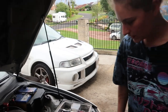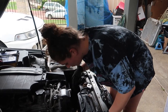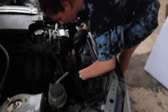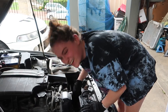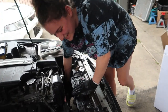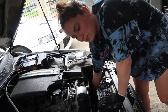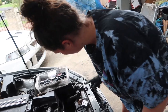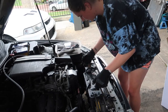So we have to take off this hose. We also have to take off the two transmission cooler lines. There's three clips. There's one here, and one down there. Then there's one hose, two hose, three hose, four. And then there's the leak point, the drain plug. And then you have to loosen these two bolts on the fan, and then you take the radiator with the fan up.